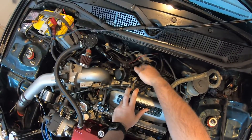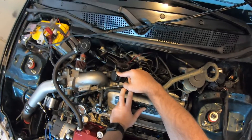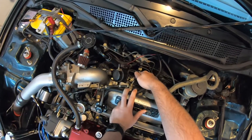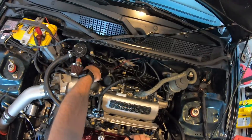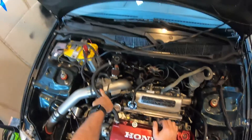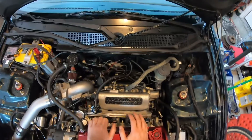This valve here is actually what controls the boost. They are hard to find, so be careful when you're putting them in — you can see I had to JB weld mine back together because we broke the nipple off. As far as your connections go, this line here is running over to a four-bar MAP sensor. You don't want to use the factory one on the throttle body — you'll never see boost on the ECU and it'll be a pain to tune.